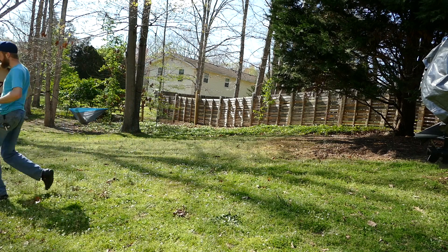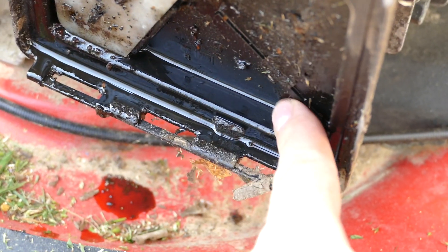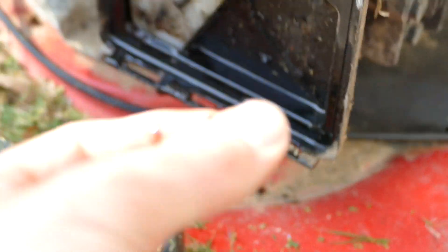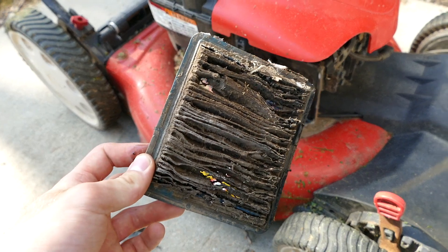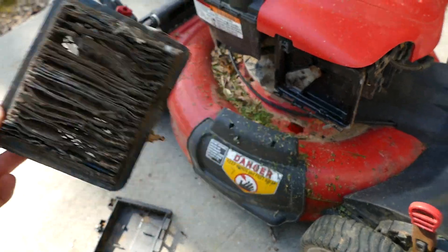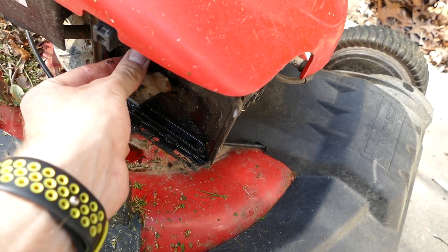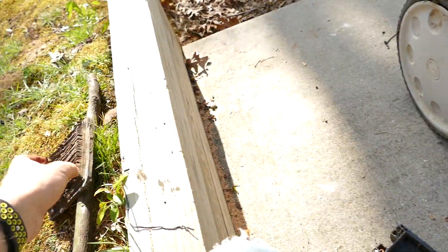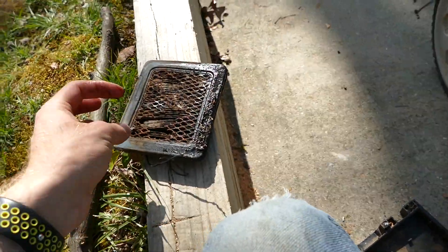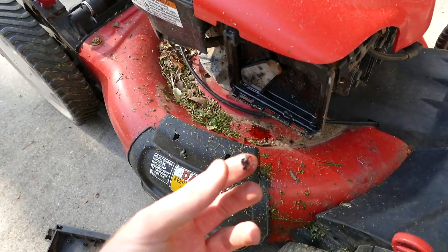Of course it won't work for you! It ran a lot better when you weren't standing there. There's something here — and this was the air filter. I should have checked that way, way, way before. Thankfully on this one I got a new air filter, so I'm just going to put that one on for now. There are bits of metal in this old one that could be in my motor now. That's why you always check the little things before you start running — you learn from the mistakes. Always check the old air filter.